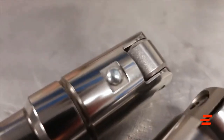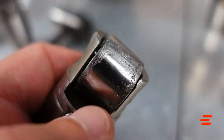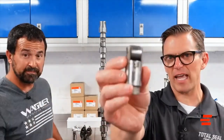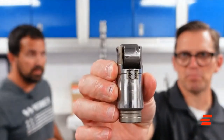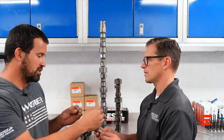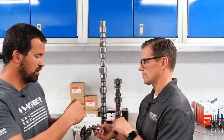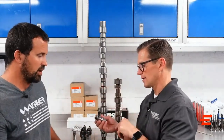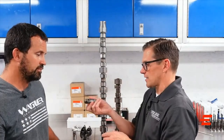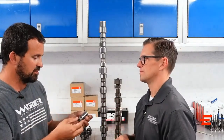They went to a hydraulic lifter. You can see the pitting on that wheel, which pretty much matches up with the pitting on the camshaft. What's interesting is there's a locating feature that looks pretty tiny. The block is machined with a radius but this is like a straight flat, so you can rotate it when there's no oil pressure on it — it's not a hard key, it's a radius. So there's actually a slot in there, and what customers are hearing through the driver's side fender well is a ticking noise, even with low miles.